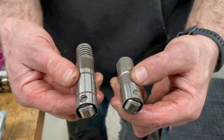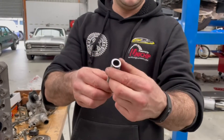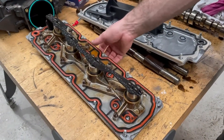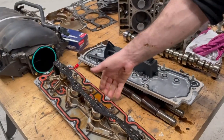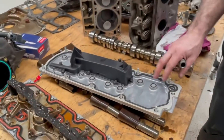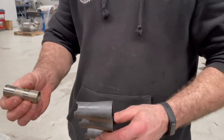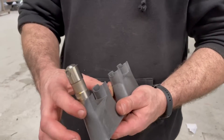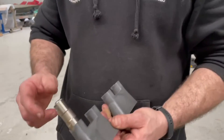To show you the difference between the two lifters — this is one of our performance LS7 lifters, and this is a DOD lifter. You can see it's got the spring return on it. It's used in conjunction with the valley cover plate here, which is electronically controlled. It's got a sensor that basically bleeds the oil off to the DOD lifters, which deactivates those cylinders. In this kit, we replace the valley cover plate with a standard cover plate that doesn't retain any of the DOD equipment. You can't reuse the factory retainers because they have a different housing for the DOD lifters. So in this kit, we replace the four retainers as well as the 16 lifters.